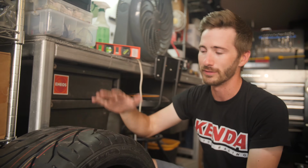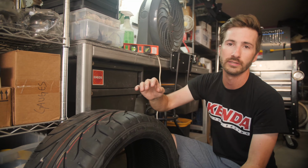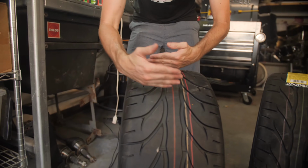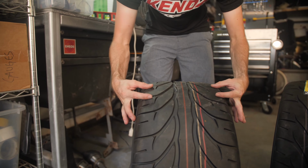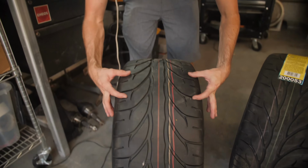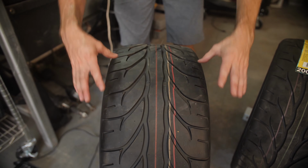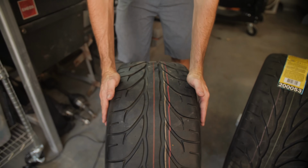The reason why we're measuring the height, you may be curious about that. Why does it matter a few millimeters or whatever? Well, the overall height probably doesn't matter all that much, but what happens is the taller the tire, the larger the section width grows this way. So not only are we going wider, but the taller it is, the more it grows this way, which gives you significantly more adhesion properties or rubber on the ground. So that translates to more grip.